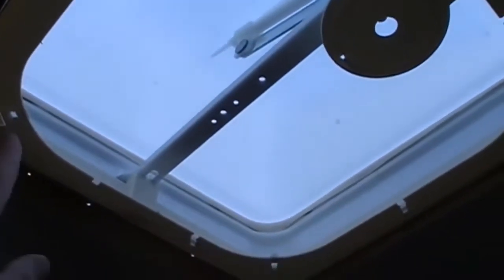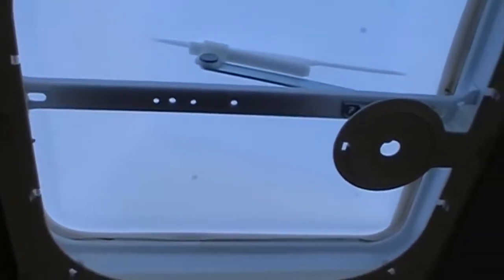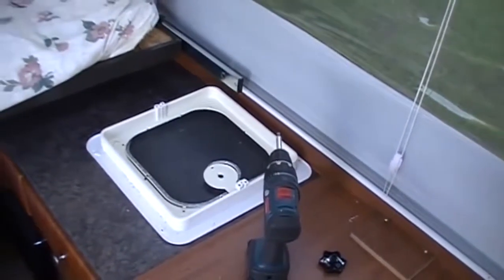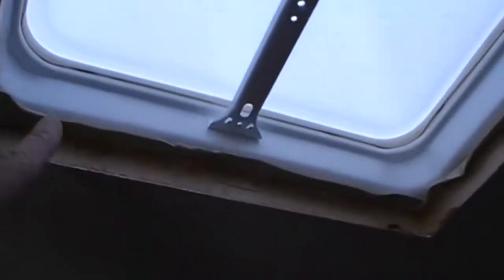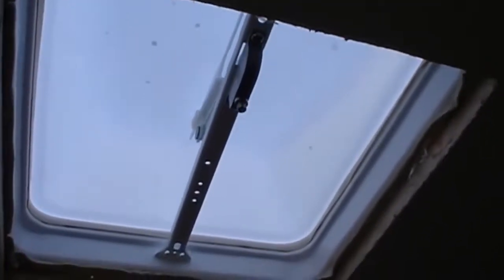And it looks like as I push up from down below that I can see the caulking material that they put around the edge here all the way around. Anyway, it looks like it's freeing up, so I think I can just push it up or pry it from the top and remove the unit from this point on. Okay, I did end up taking off that trim piece, that wider one, and it was just actually pushed up there, and it was kind of stuck to this caulking material that they have all the way around the edge. So I've got that off, and now it looks like the vent will just push right out of there.